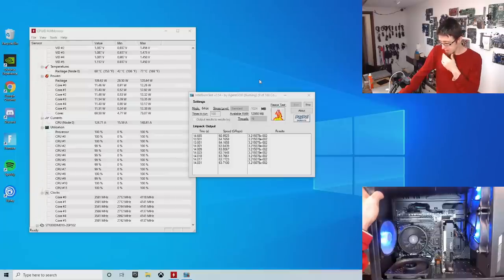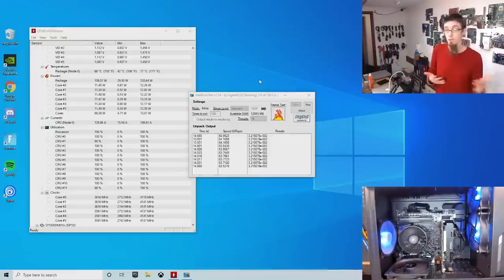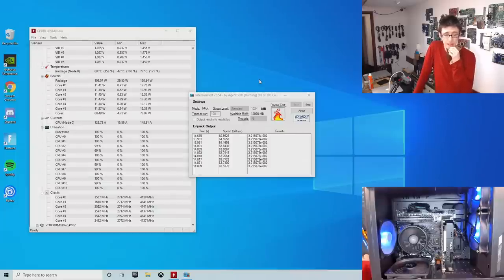The other possibility is, again, it's just bad memory. It's probably worth my while running a mem test on this anyway, just to make sure it's not straight up faulty RAM. Now that we've actually proven that this is a memory related fault, I'm actually swinging back around to running MemTest86. Once we've confirmed that this is an XMP issue, I will run that memory test with XMP disabled, to make sure we're looking for physical defects in the memory rather than just a squeaky XMP profile.